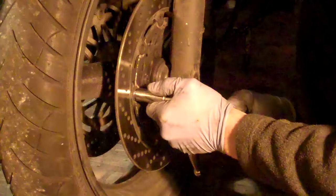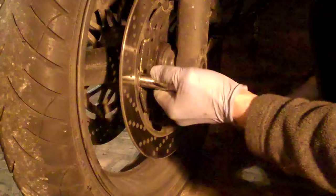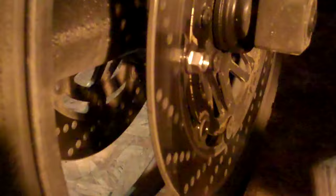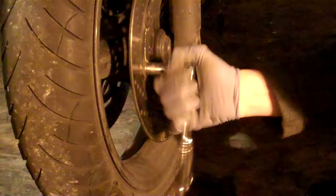This is not something I invented — there are videos elsewhere on YouTube, it's a common thing mechanics in workshops will tell you, this is how your dealer does it. All you do once it's done up is keep rotating inwards and these will give. Now the bobbin is spinning. You can see the bobbin itself spinning inside, and we just take a little bit of brake cleaner and drown it while spinning — simple as that. Now some people consider it correct to lubricate after cleaning, but personally that terrifies me — I will never put lubrication of any description on a brake bobbin.